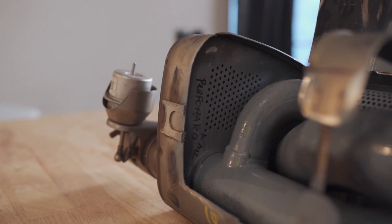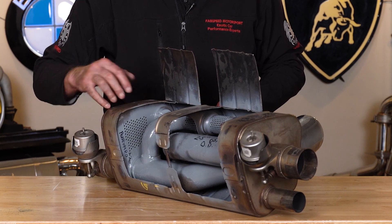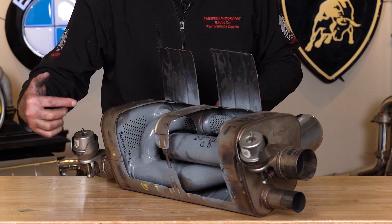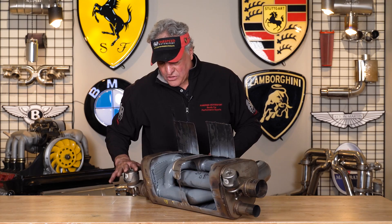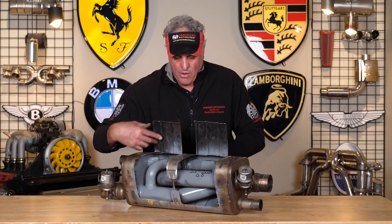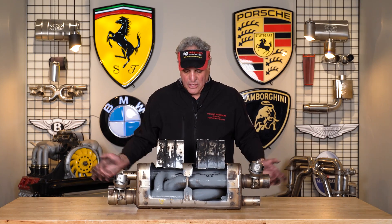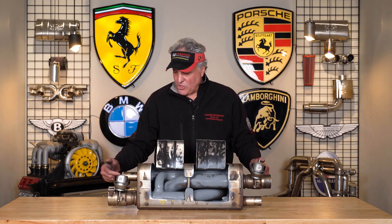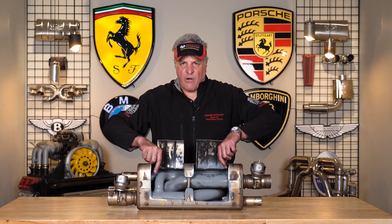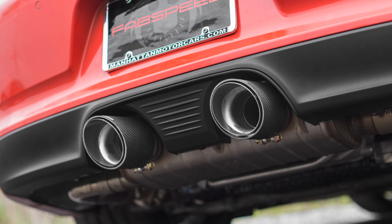You think that's bad? So the exhaust valve shuts, exhaust goes through here. If you look closely, you can see there's a perforated wall right here. The exhaust comes in here — it's about an inch and a half of packing and material — and the exhaust has to fight its way through this perforated wall. Once it fills this chamber up — remember, this is all covered — it's going to reach a certain pressure. Valve's still shut. Then the exhaust has to migrate through these perforated cores and goes through each of these tailpipes, because air has to follow the path of least resistance or it'd be hydrostatically locked. So: valve shut, exhaust goes through here, fights through perforated walls each side, fills the chamber, reaches pressure, goes through the perfs, through the pipes, and right out the tailpipe.